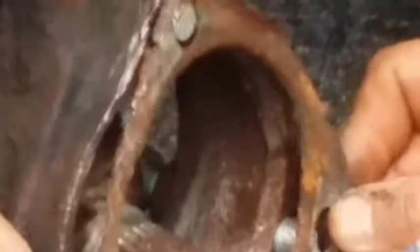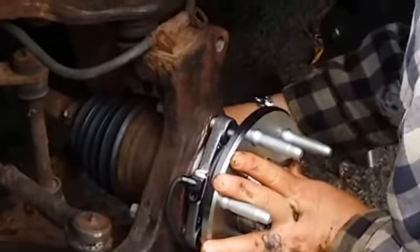I'm going to throw the hub assembly on now, with the spacer. I was tempted to just throw the spacer out because it's in such bad shape — if it's really deformed it goes in the garbage. I can't find a torque spec for these hub bolts, so I'm going to go reasonably tight, around 80 foot-pounds. You don't have to go crazy tightening them in, but don't put them in too loose either. Make sure you snug them in. If you're using a breaker bar and put a reasonable amount of force on it, they're definitely going to be tight enough.